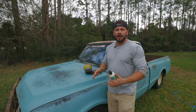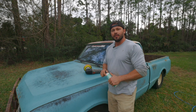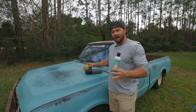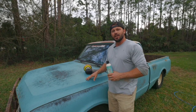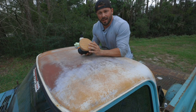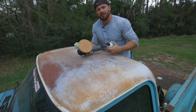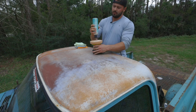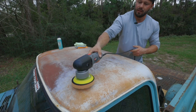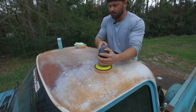Now that we've scuffed the entire truck with a light Scotch-Brite pad and all-purpose cleaner, I want it to be a little more glossy before we put on the Sweet Patina Sauce. So we're going to grab their Century Polish with an orange cutting pad — a light cutting pad — and see if we can bring back a little bit of shine to this paint before we put on the sauce. I'm definitely no pro when it comes to cutting and buffing paint, but we're going to start with a small area to see how it looks. Do four or five dime-size drops on there and spread it a little bit. I've actually never buffed patina before, so we'll see how this looks.